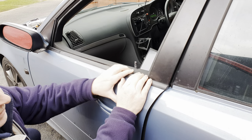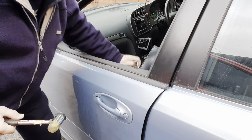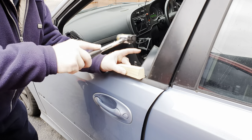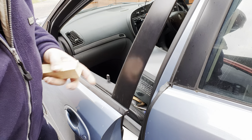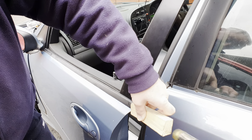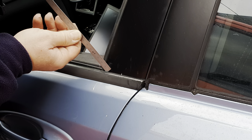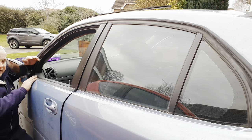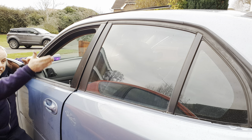Refit your waist seal the opposite way to the way you got it off. Press it onto the flange and press it down hard to make sure it goes all the way. Use a plastic or rubber hammer — if you haven't got one and need to use an ordinary hammer, use a block of wood. Where I've put this back I've ended up with it overhanging the end of the door a little, so I'm going to use my block of wood and hammer to push it forwards. Despite my best efforts I still ended up with a small gap between the seal and the door finisher, so I'm going to close that gap off with a little silicone sealer.